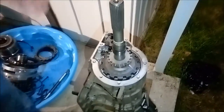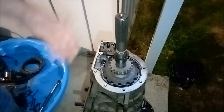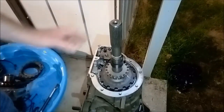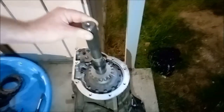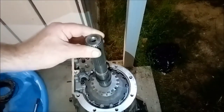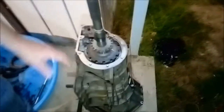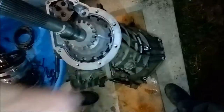The reason for making this video is that there are no videos out there on tail shafts or on intermediate transmission vibration, which is what I was getting from my E350 Super Duty cargo van. The transmission is still underneath the vehicle, but you can take the drive shaft off, pull it out, and shake it side to side. This 2000 model and my 99 are basically the same transmission, except this one reads speed from a magnetic sensor on top instead of a wind-up speedo gear with splines on the side.